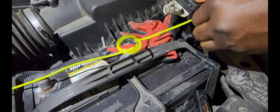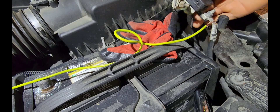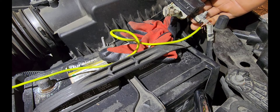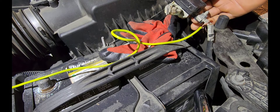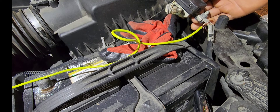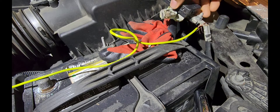What we're doing here is forcing the vehicle to quickly run out of power. Some people say just turn on the headlights, but if we don't drain all the power from the vehicle and we reconnect, the small amount of power left will save the code. The code can be saved if there's still power running to the vehicle. If everything is completely drained, the code won't have any energy to stay in the system.